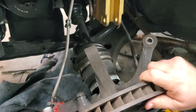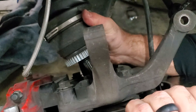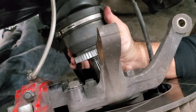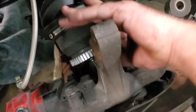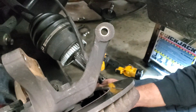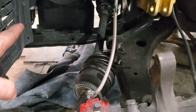Keep going down — that's why we took the brake lines and ABS sensor off, because if you don't, you're obviously going to stretch them, and that's really bad. Try to push in on that axle and kind of jiggle it out. Don't get a pry bar in there and start prying on the ABS teeth — those are pretty brittle and will break. Use your hands and work it out, going forward with it to clear the brake line.